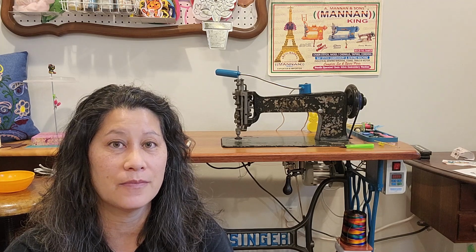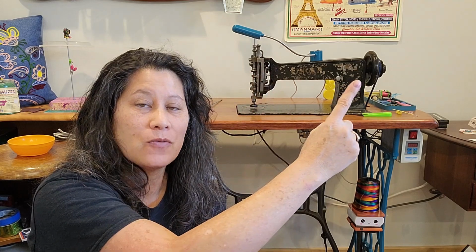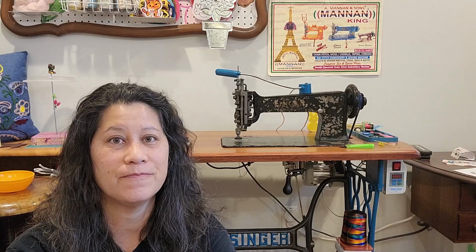Okay. So sorry for the long intro, but now I'm going to show you all the slides on how to take this apart. And I might put some arrows or something in the slides if I think it's necessary to edit, but it should be pretty much self-explanatory. Just be careful when you put it back together that you're careful with the alignment pins. And when you go to take it apart, the alignment pins might be a little stuck, so you might have to wiggle it. It's not going to come right off, because the face itself is going to be held in place with alignment pins, and those are usually sticky. So after you remove the three screws in the face and you loosen the one screw on the gear that's holding the long shaft in, the face and the long shaft should slide out of your machine, but it may be stuck. All right, thanks for watching.